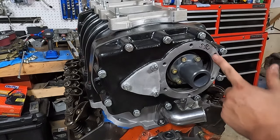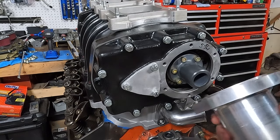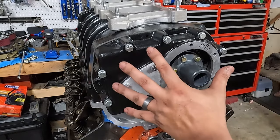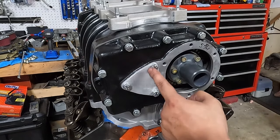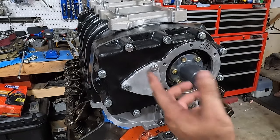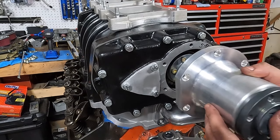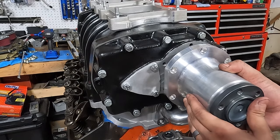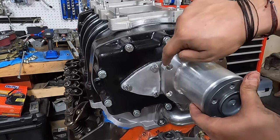And normally there's a gasket that goes right here, but again, we're just all dry. This is all going to come off again when it's getting installed. One more note, this is a standard or stock style front cover. You can see there's this triangle here, and this is where you'll add fluid when the time comes. But you'll see too, this has a flat section. That's because when you're mating these two, you need that space, because if this was fully round, there would be some interference issues.